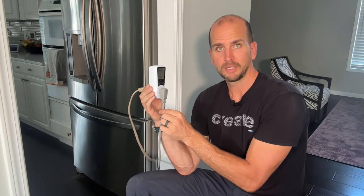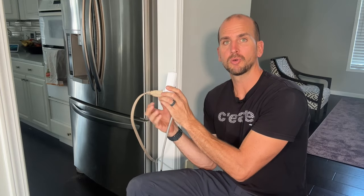What I'm doing here is using an energy watt meter. I have the gray power cord coming from the refrigerator freezer and an extension cord going back to the 120-volt outlet behind the unit. This $13 device helps me monitor over some duration of time the overall power consumption and a few other critical variables, which I can then use to actually assess my need. Without power in the house, I'd be powering this with my portable power station, so I need a good understanding of this appliance or I might select the wrong unit.